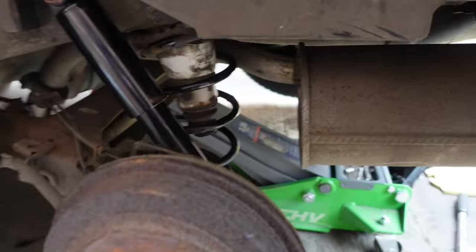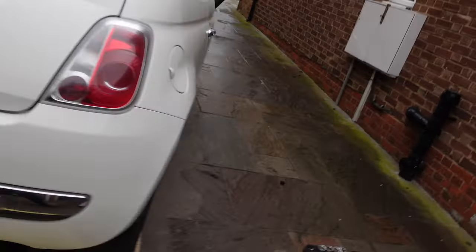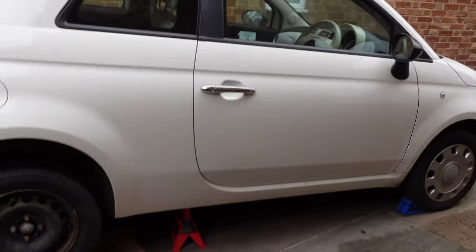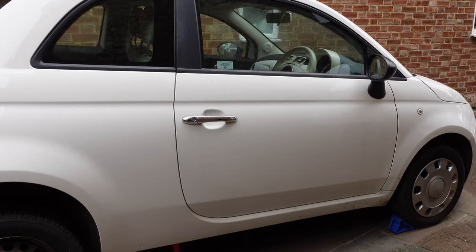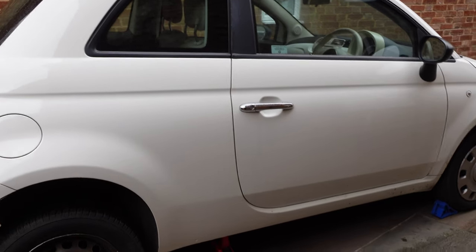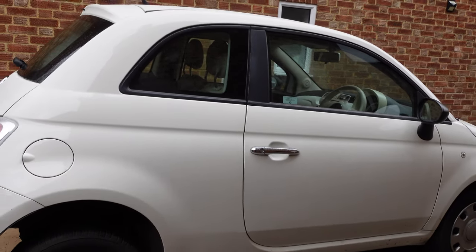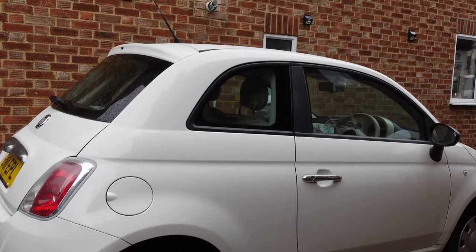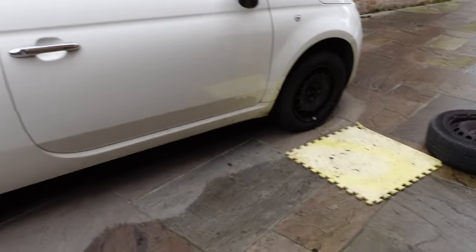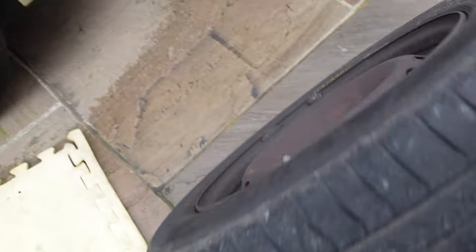And then all we've got to do is do a final clean on the inside, just to get it up to spec. And then we've got to put that new stereo in — the media player thing. And then I think that will be done, apart from the clean up on the outside, and it'll be ready to go. I wanted to get this done by hopefully the weekend, I think it will. One thing I remembered that I needed to do — I needed a new tyre on here. Again, that was an advisory on the MOT from January. The tyre was worn on the inside. There's barely any tread there. The reason for that, I believe, is something else I'd forgotten about that I pointed out in the first video in the walk around — the tracking needs done. So the tracking's clearly out. You wouldn't know it to drive it, but the steering wheel was at sort of just before one o'clock.